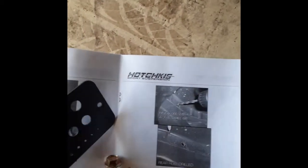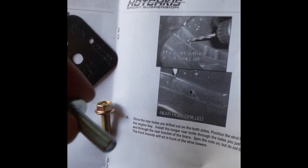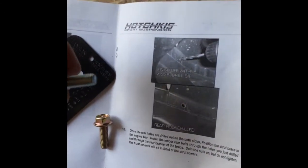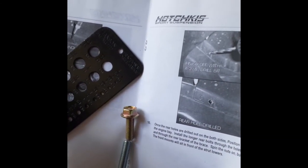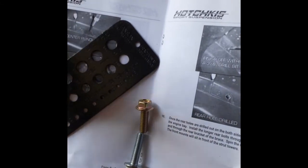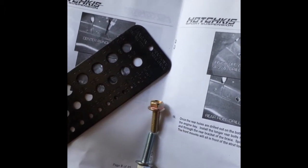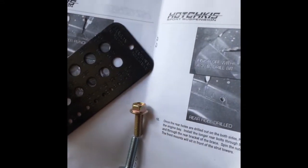I can only assume the manufacturer told you to do 3/8 so that you get a little bit more play with the screw going through. 5/16 is going to be a little bit tight. The disadvantage of 3/8 is you're going to have a longer bit, and you may not be able to get that bit through the way I showed you. But we'll try either way. And this might be the case where we have no choice but to bring out the 12-inch bits and go from below. But at least to make the guide hole that they tell you to, you can do this from above.